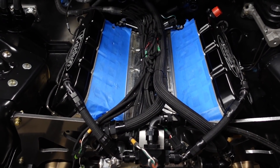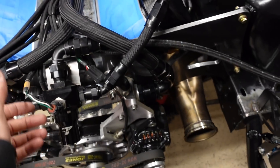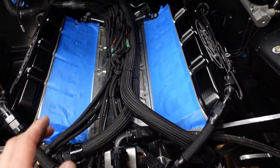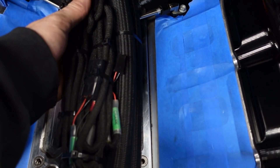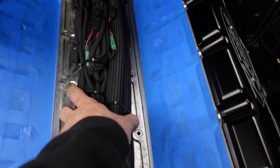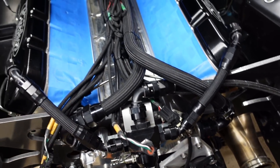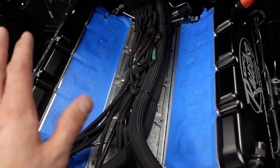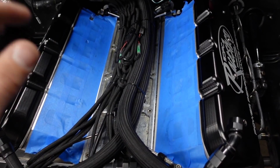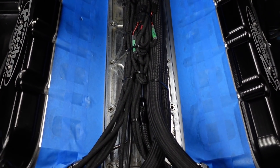The road to getting it running — I've spent a lot of time going through and figuring out the length of each connector and where it needs to go, which you saw in the last video. I just finished tidying all this up, bundling together — oil pressure sensor's in there and plugged in, and the ones we're not using are zip-tied up back here out of the way. The rest are to length, all together nice and neat, coming out to the front. I'm pretty much finishing this up; intake's about to go on. Making sure all the coil and stuff is good before I bolt the intake on — this stuff is accessible once the intake goes on but it's a lot harder to get to, so I want to make sure everything's perfect now rather than later.